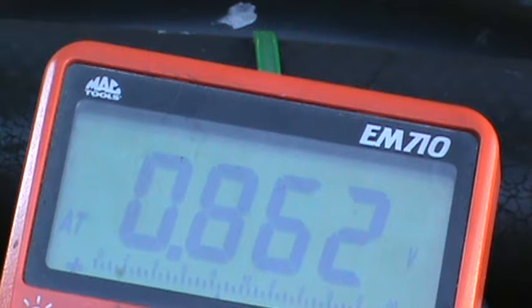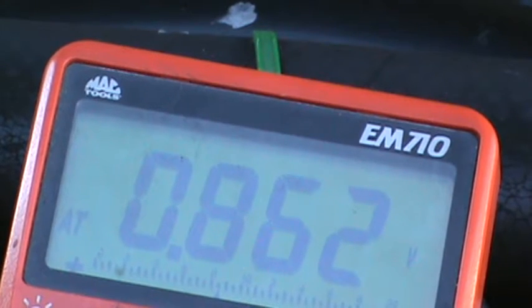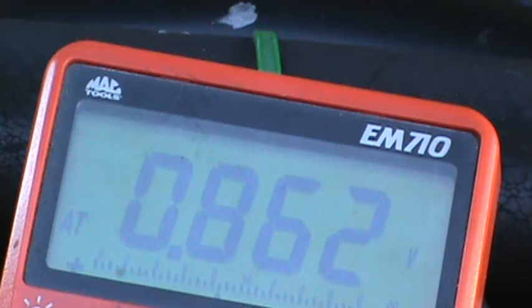So I'm gonna push that plunger in and out and watch. Okay. Oh, and when you push the plunger all the way in on this thing, it should not read any more than 5 volts. If you push this plunger in as far as it can go, if it reads above 5 volts, throw it away, buy a new one. Okay. And again, if it acts erratically like this one does, throw it away, buy another one, because it's causing your problem. Okay. So let's take a look here.